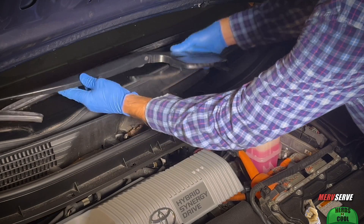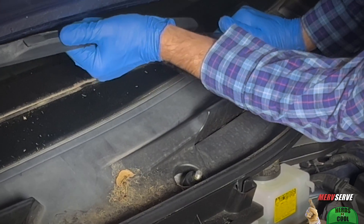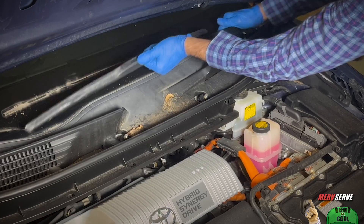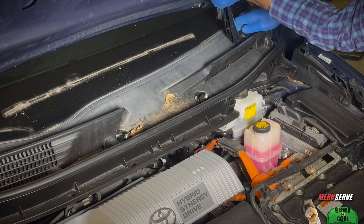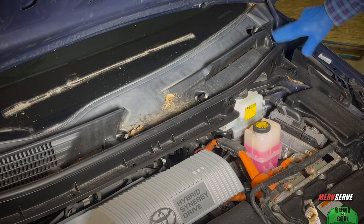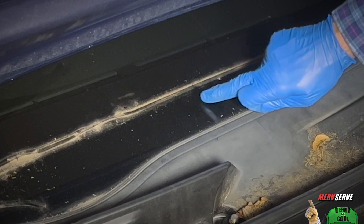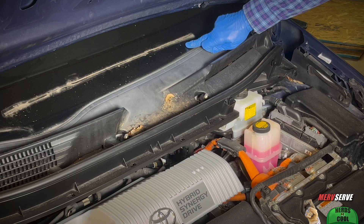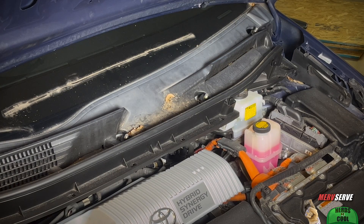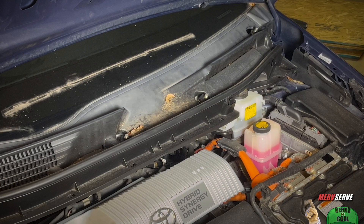The wiper arms just come right off, and you want to bend this one a little bit at the elbow. It releases the tension, and it makes it less of a struggle to remove it. And to avoid confusion when it's time to put these back in place, I use the outline of that there to my advantage. Let's just call it an organic calibration feature. Are you with me? Does everybody understand what Mother Nature is giving you here?